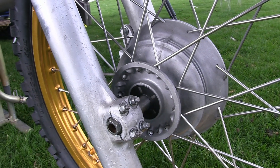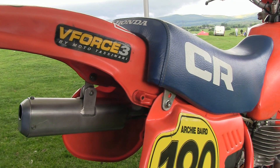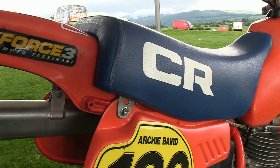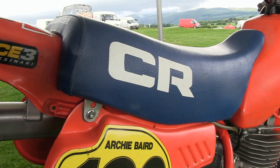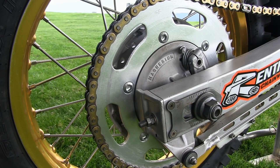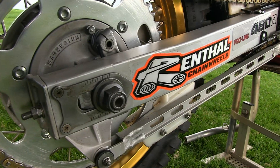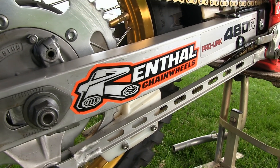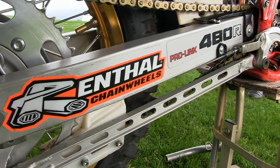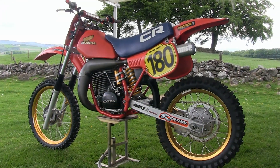Surprisingly, these Hondas were still using drum brakes in 1983. The Honda CR seats were taken straight from the works bikes of the time, and as you can see they extended the front section over the tank to allow the rider to shift his weight forward. Weight saving is also evident in the magnesium rear brake back plates, which shed precious grams from the bike's overall total. The Honda ProLink swingarm and rear suspension system was without doubt one of the best of all the big four motocross suspensions in the early 1980s, with 20 rebound and 12 compression settings to choose from to fine-tune the ride.